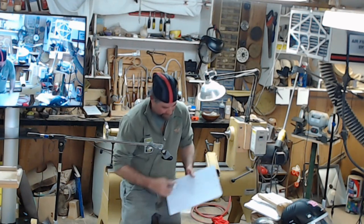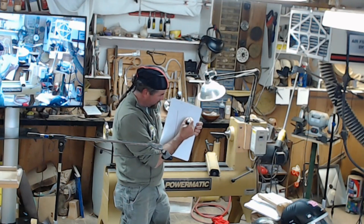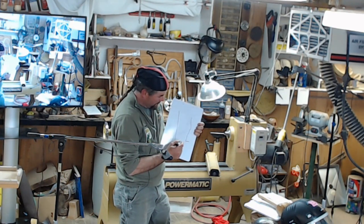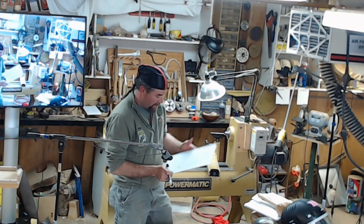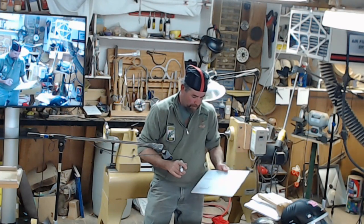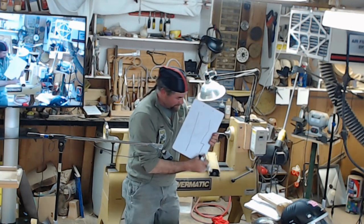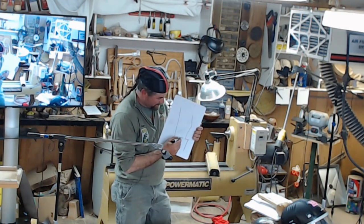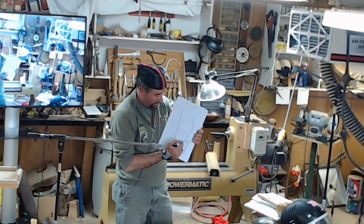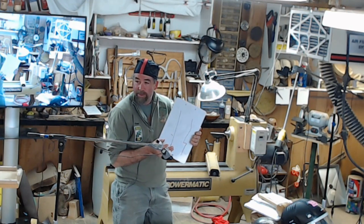Here's another one that they do. Say you do your regular open face. We're going to go with the regular, because I'm going to say regular, it's not a standard. There's your notch. What was your question again? Plunge cut. So what they do on these is you'll start your cut. Instead of coming back here to start your back cut, they'll do that plunge cut right at that 2-inch mark where they want to keep their hinge wood.